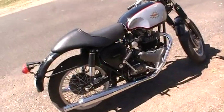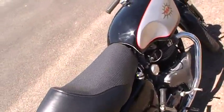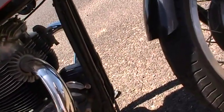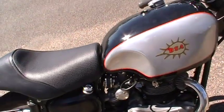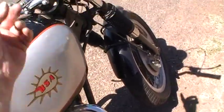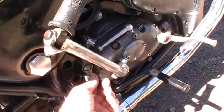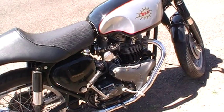This is something I showed you on another YouTube video about modifications to BSA twins. One of them was to fit this oil pressure gauge via a tube down here. I did the kill switch, and that allowed me to fit that oil pressure gauge. This is the bike I fired up that particular day just to show oil pressure. I've got a valve in here that I can turn the oil off to the engine so that it doesn't drain down, like a lot of these things do with the gear pumps that BSAs have.